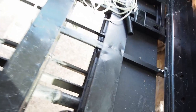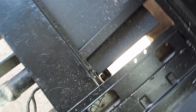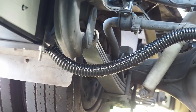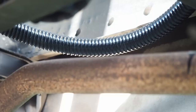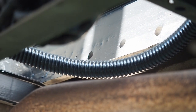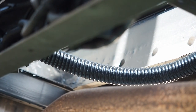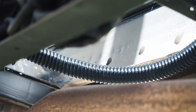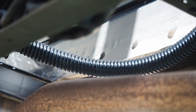And then with the black water, I've already got one hose attached, which is down there, you can see. So there's a black water hose. Now I'm using a macerator pump to pump it out, so that little bit of a lift is not going to make a difference because the pump will suck it up. And over there on the side of the bus, I'm going to have a box which you can open up from the outside, which will have the macerator and two shut off valves, one for the black water, one for the grey water, and that's where it'll get pumped out from to the dump.